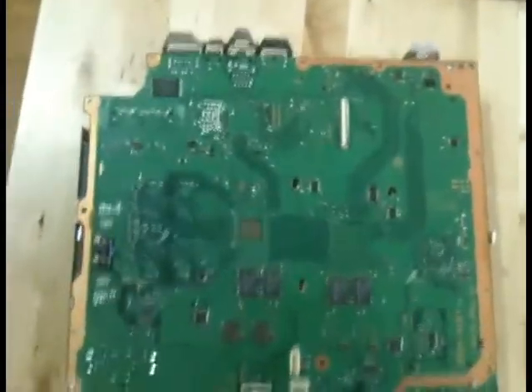We can just pull this whole assembly straight up. You can already see it started to separate right there from the motherboard, and the actual board itself is just going to come right off of all of this. You have to bend these clips out a little bit in the back — you can see it's still holding on because of this. You've got to make sure it lifts straight up rather than trying to pry it off to the side, and this can be a little bit tricky.